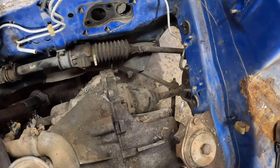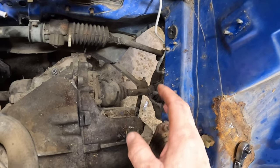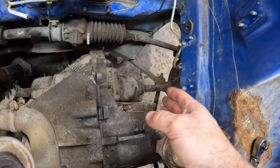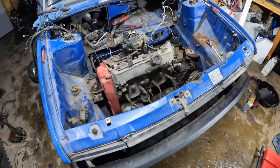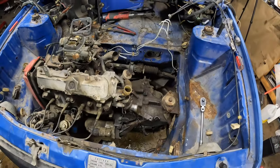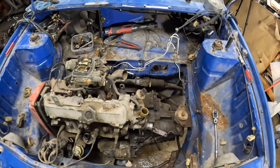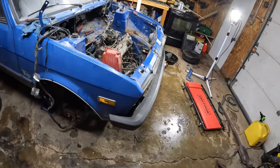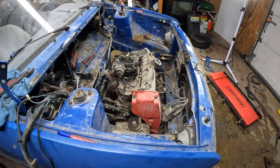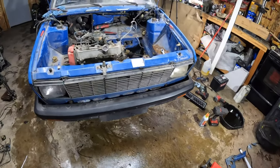The boots are still good, so I might just remove the flanges from the transmission and keep the axles — never know if I need them. I already drained the engine oil and transmission oil. I'll take the axles out and keep them, especially since I have to cut them in half and weld them. The original side, original bearings, and spindles will stay Yugo, and whatever engine and transmission I decide to use I'll have to cut the axles, get somebody to weld them, test everything, and then send them to a shop like DSS to make me strong axles.